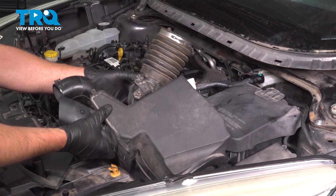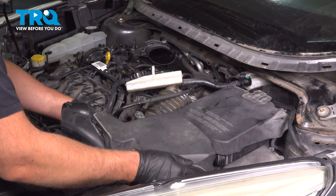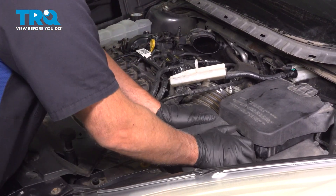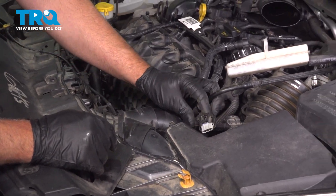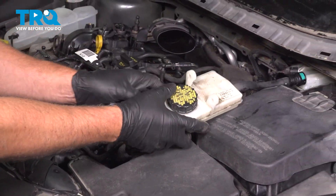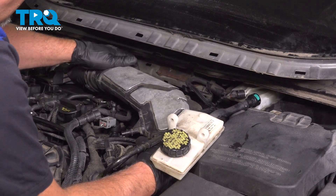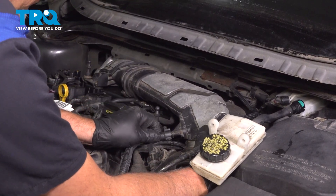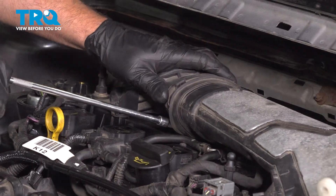Take the air box underneath the wires or hoses. Get this to line up over here, then push it down into the bushings. Relatch that — that's good. Take the connector and plug that into the mass airflow sensor. Take the hose intake duct, get that lined up. Connect this hose here and lock that down. Tighten down the worm clamp and snug that down.